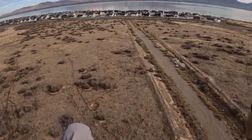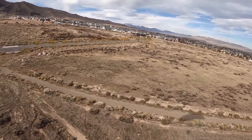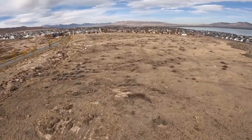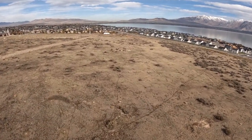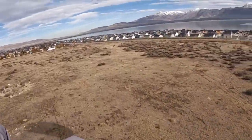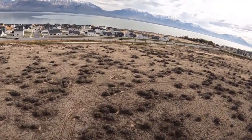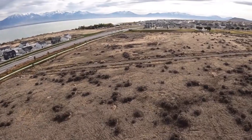Totally unbalanced. For a skilled pilot you could get away with it because you know what to do, but for someone new it would be a catastrophic nightmare — you're going to get them killed. What's going to happen is they'll hit the throttle, it'll torque right, the glider dies off to the right, they let out the throttle and it shoots off to the left diving them straight into the ground. I've launched so many first-time students, I know exactly what they do. The flat top is incredibly stable — everything is perfectly designed.